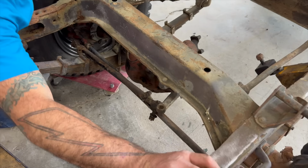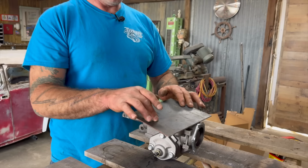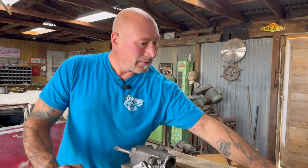Set this box up on the table. All right, so with this steering box, to get this part started, I'm going to bring a piece of steel in and discuss the issues with this. This goes onto a stamped steel frame that has some contour to it. When you partner it up to a flat steel plate, right? We confronted that in a different project. So we're going to see how much we have to space this off. We grab a couple large nuts, see what we got.